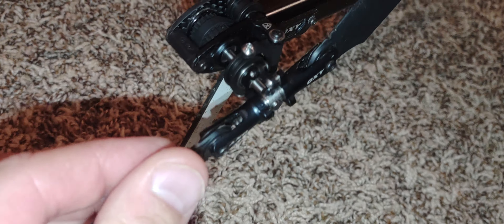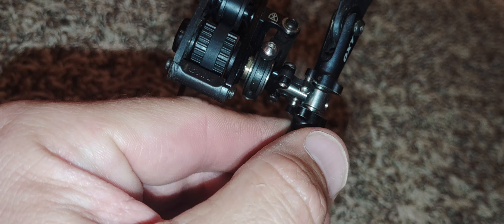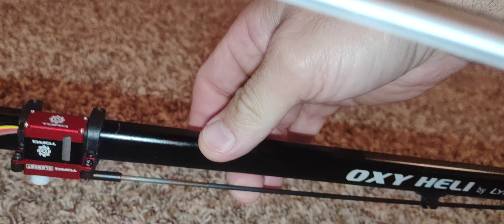It's not an Align 470 light - just an ounce or two heavier. Never broken any tail grips, dog bones, the pitch slider, or the rear tail box, which I can't say the same for the Protos 380 MSH version with the aluminum tail box - it's single-sided and bends and breaks bolts. Never broken a tail fin - this is the original, I think it's two-and-a-half or three-mil polycarbonate, it's insane. Never broken a pulley or the idler. These are original tail blades and they still run smooth. Never broken a tail push rod either.